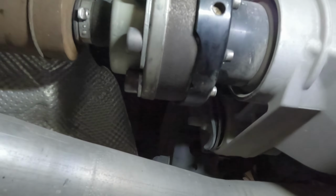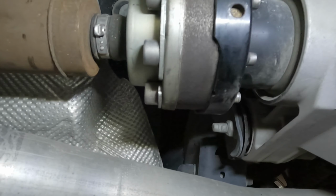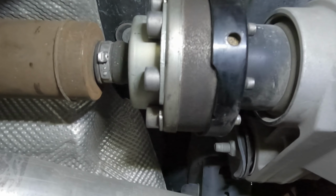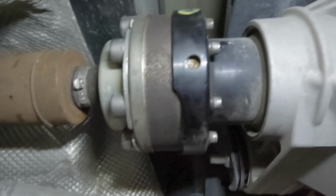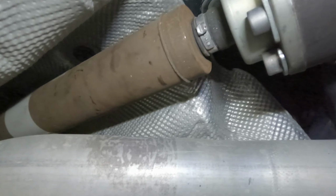Okay, so next you want to remove the drive shaft. Let me get some light down here. There you go, the drive shaft. They're hex bolts. Ugh. And there was some weird kind of thread locker on these things. It was almost like it was silicone. Not that it was really hard to remove, but you couldn't just spin them with your finger. You had to use a wrench the whole time. So this step took forever because there's eight, I think, bolts on the back, and there's six on the front. Halfway up it. Man, I'm getting too old for this.